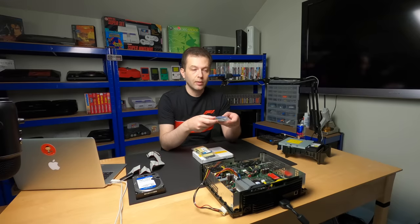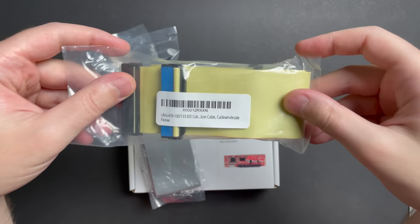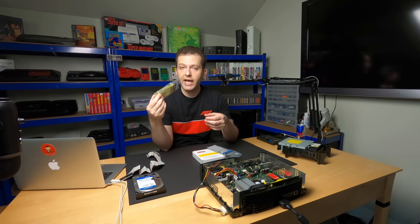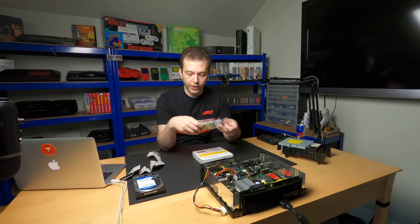and when it comes to the ATA cable, you really want to get a 24-inch version. It's just going to make your life so much easier. I did pull this off with an 18-inch version. These are cheaper and they're easier to find, and it works, but you don't have an inch to spare. So save yourself the headache, pay a few extra bucks, and just get yourself a 24-inch cable.